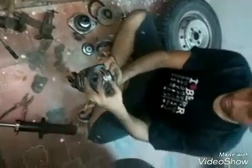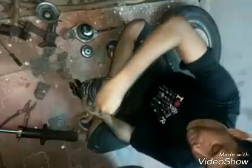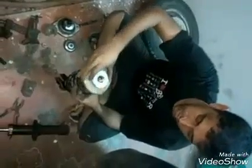Here, first we need to insert in the reverse way. First this should come out, pull it maximum, then put your spring here. Make sure it gets locked here. There is a groove here for this spring to get locked. Keep it there. Then in reverse way, need to place all the things back. So we have this washer, we have a groove here to hold it. Then likewise we have a groove here, need to place it there back.